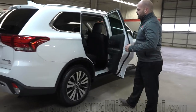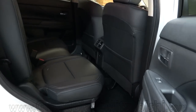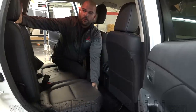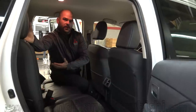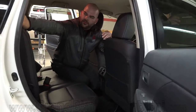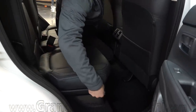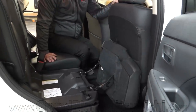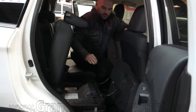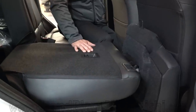Let's take a look at the inside — specifically the second row. Things to appreciate about it: you can slide the seat back or forward depending on how much leg room you want or how much access you need to the third row, making it easy to get people back there. You can also fold the seats. To do that, first pull the tab on the side of your headrest, then pull the tab on the bottom portion, then there's a plastic piece — the headrest goes right in there — and now you're folded flat. I'd recommend sliding the seat back first before operating this.